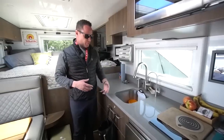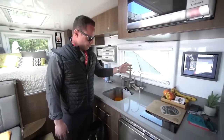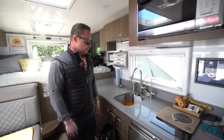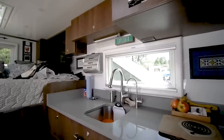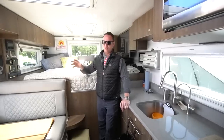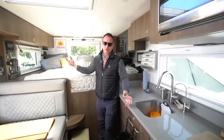I've got a water purification system here. The main truck has a three-part, three-filter system — carbon and a couple other filters of different size microns — and then this adds UV light as well. I can pretty much put any water in here and use it for brushing teeth or a small glass of water. 130 gallons of fresh water, and I have a system that I can take to a pool — chlorine or not — a stream, and draw from that source. It goes through another three filters, so by the time it comes out, it's gone through seven filters total. If you can see through it, I can use it.